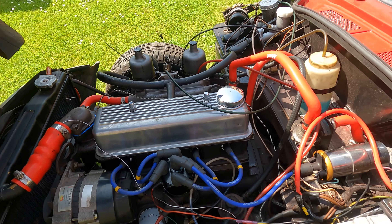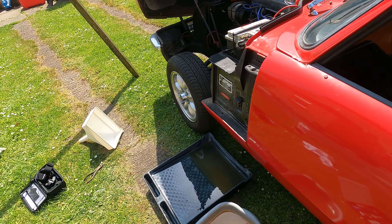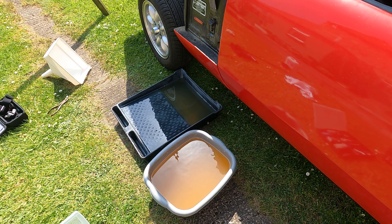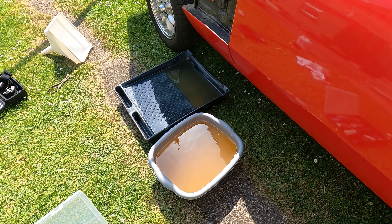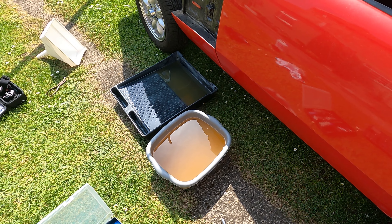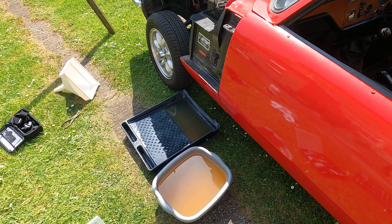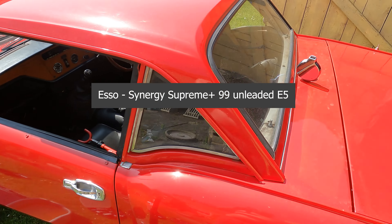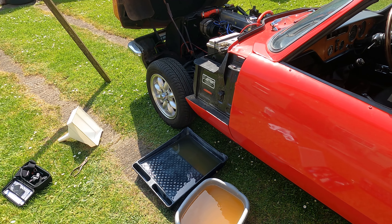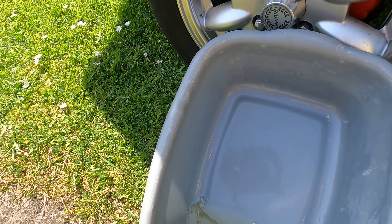I'm putting it back in the car using the filler and a big white funnel, pouring the fuel in nice and slowly. Next time I'm going to drain the fuel I'll put fresh fuel in, but just for now so I can move the car around I'm putting that fuel back in. Looking at the condition of it though, I'm going to bin that fuel over the next few months and before we drive it we'll put fresh fuel in — ideally 98 octane with lead additive in it, because this car hasn't got the hardened valve seat conversion.